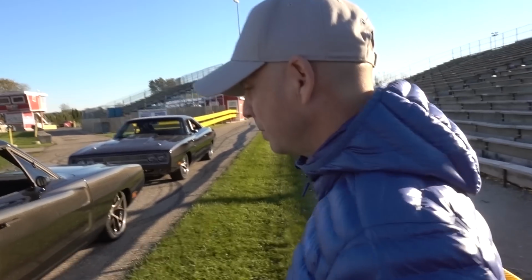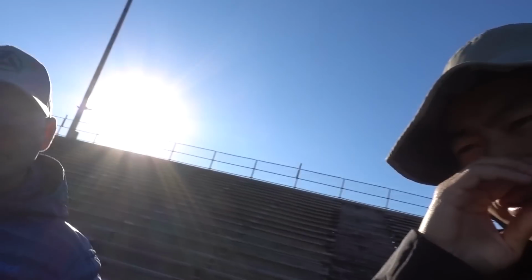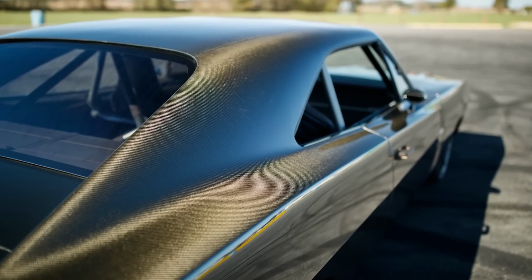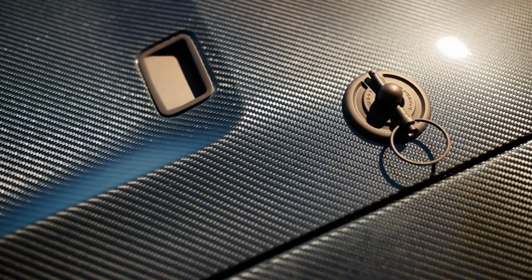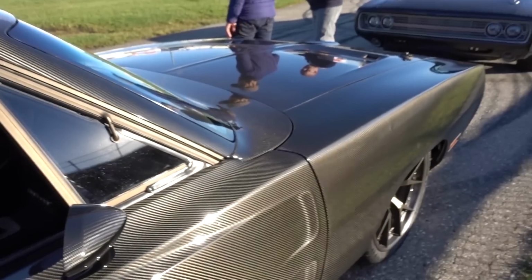Right, very cool. Another question that I'm kind of curious about: how hard is it for you guys to actually continue the same direction of the weave throughout the whole car? Yeah, that goes right back to the craft. First, you're going to look across the car, and when you lay carbon fiber into a mold, how that weave might deviate and distort, that again takes that eye and that experience.